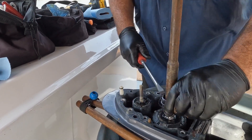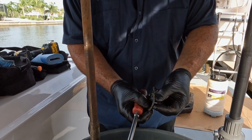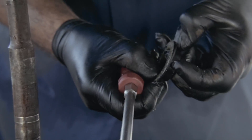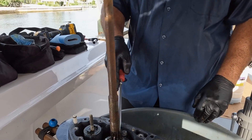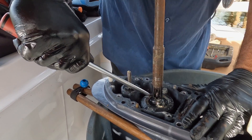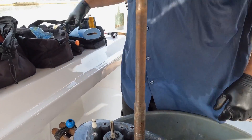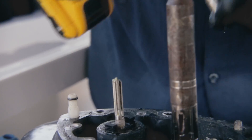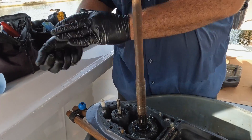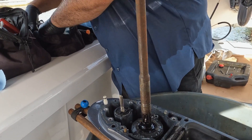This is the oil seal cover — always replace these if you're replacing anything; it helps keep the water pressure out. When it starts to delaminate off the base, that's a good sign of needing to replace it. You can actually see how dark this gear lube is on the seal, and when you see the new one put in you'll see how it's supposed to look.